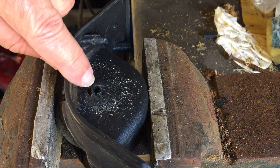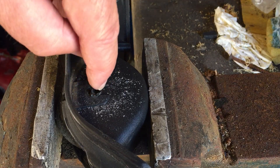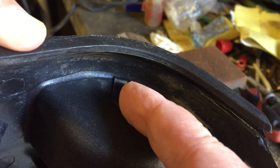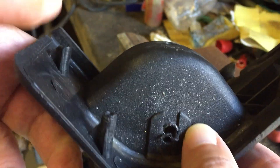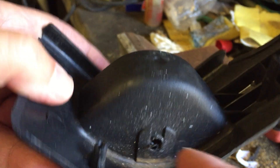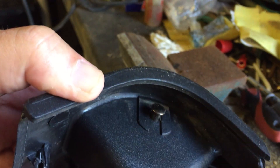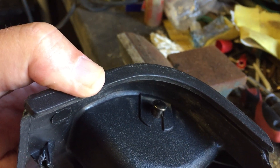As I finally removed most of the rim of the shaft, I pushed down and it popped out the other side. One thing you might be able to do is put a pair of mole grips on that and try to pull and wiggle the shaft out. I didn't manage it on my previous two attempts because there was still too much of a rim left, but it's worth trying to save the next step.